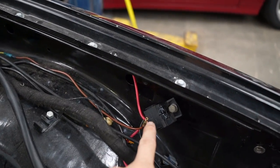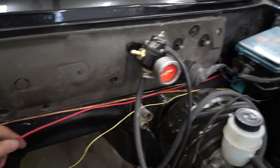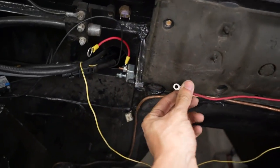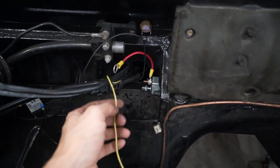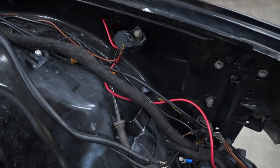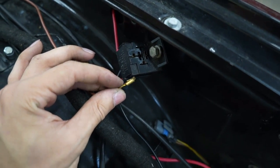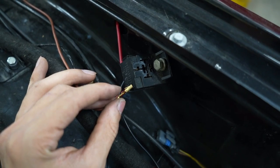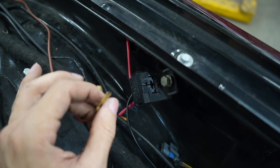I started to run the wiring for the relay behind the fender. One of them is good but it's a little bit short — it comes out and I need to extend it a little bit just to get to this circuit breaker. This yellow one goes to my ECU, so I needed to pull it either out of my ECU or the relay. I pulled it out of the relay — all you've got to do is push this pin, it sits exactly like this when it's inside the relay. You've got to push that pin so it's flat and then the pin will come right out.